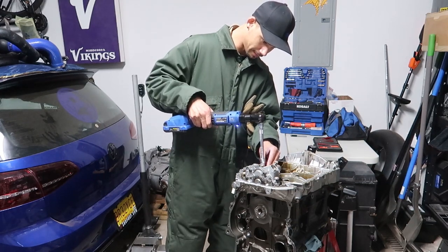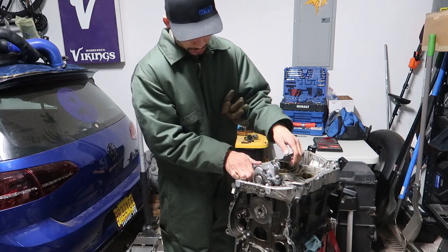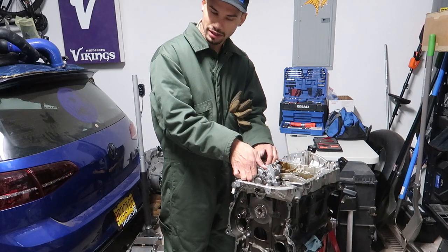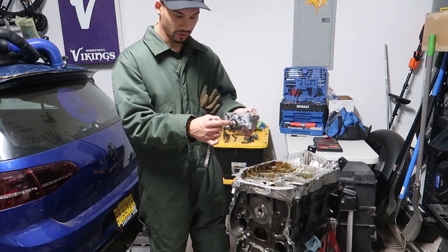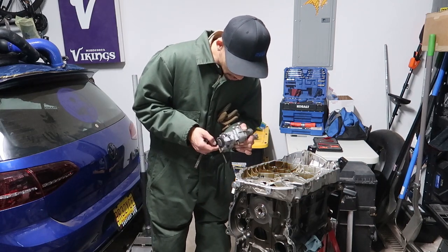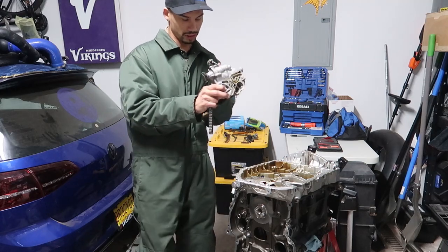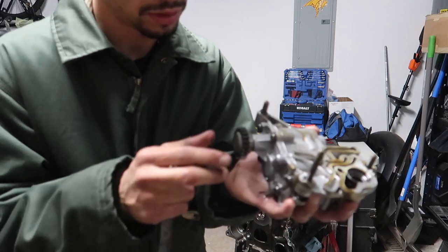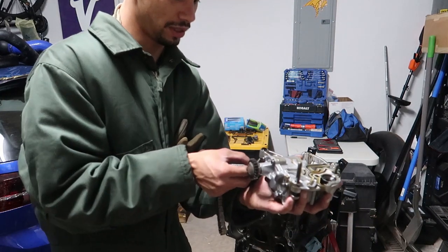I'm not following the book for this so I don't even know if I'm doing this right - we're gonna learn today. I watched enough Jimmy Oaks to know how to remove oil pumps. You guys saw Healthy Hall's engine - I think it was out of the E36 M3 - the guide for the oil pump gear failed, caused it to jump timing, and destroyed his motor. Even welded it and it's still messed up. There's a screen and some oil - just those three T45s on the bottom.